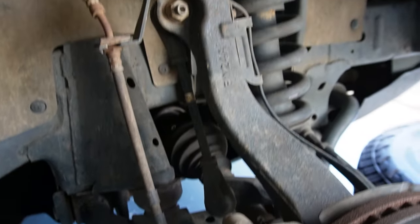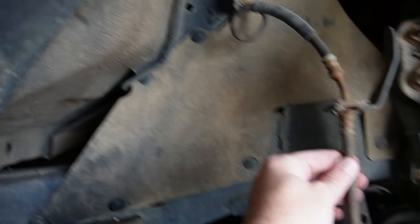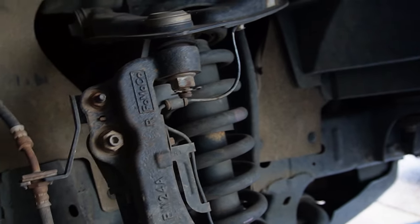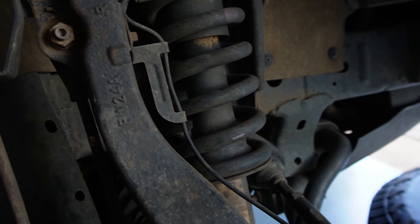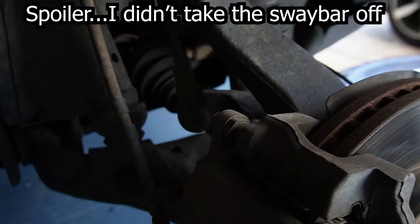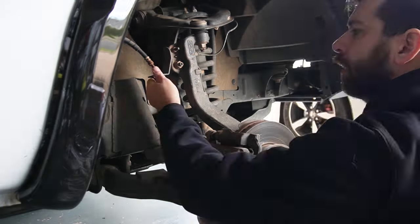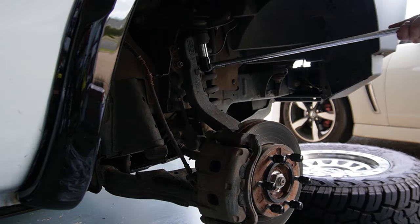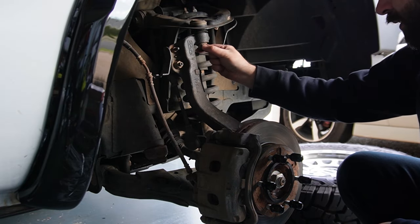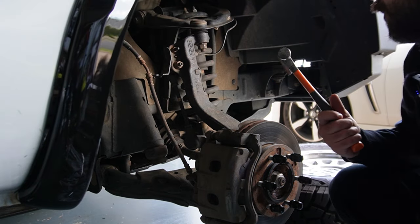Apparently what we need to do is get these lines out of the way and then get this brake line out of the way as well, because once we crack this one here this is all going to fall down, so we don't want anything to stretch when that happens. I think I should probably take the sway bar off as well, just to give it a bit more room to move. A bit of leverage is actually amazing. I don't actually own a mallet so I don't know if this is going to be enough force. Trusty old hammer.